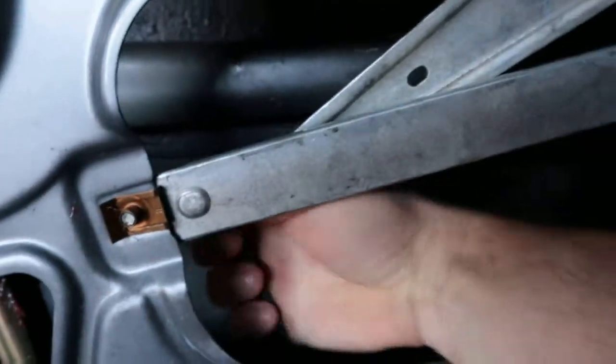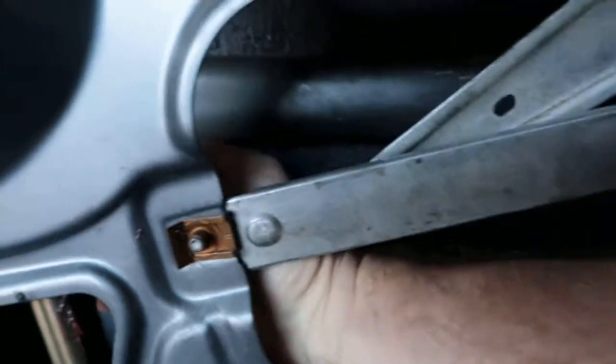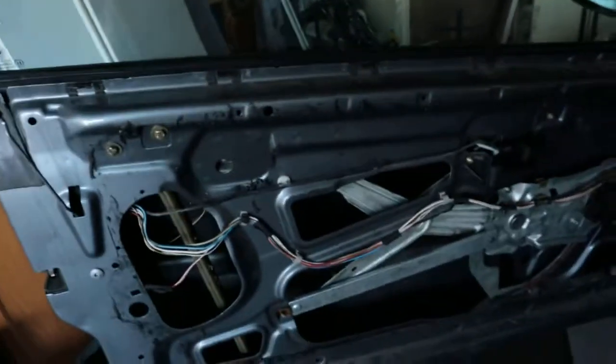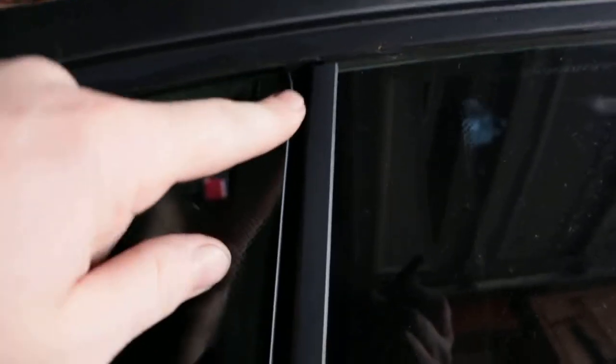Let me show you how to adjust that. Mine is already adjusted so I don't have to do anything, but sometimes it will overlap. All you have to do is leave this bolt on the other side loose, then move the window — you can see the whole thing shifts up. Once it's in the right spot, tighten the bolt. Now you can't really move the window. You close the door and it goes all the way up. I can see the gap and could readjust it a little bit, but it's really close and finally the window is working.